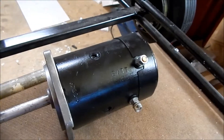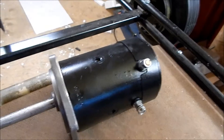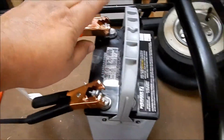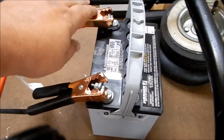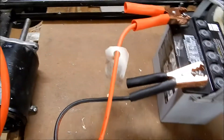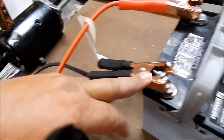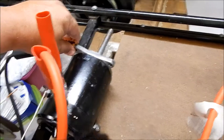I'm going to try that now with the battery I have sitting here and see if I can demonstrate that for you. For the purposes of this demonstration, I've gone ahead and hooked the positive terminal from the battery directly over to the battery terminal on the motor itself, and I've connected the negative terminal from the battery over to the chassis ground on the motor.